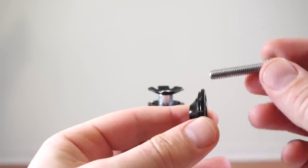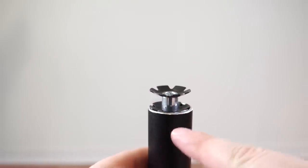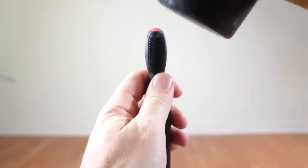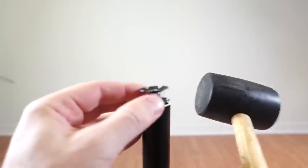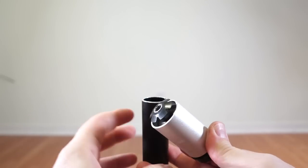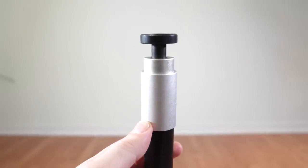At the top of this steerer assembly you have the preload bolt that goes into the top cap, and this has to be screwed into something — that something is the star nut, which has to be pushed inside the steerer tube. Installing the star nut can be done on the cheap with just a small screwdriver: slide it in from the top, get a mallet, and start whacking it down 10 to 15 millimeters. However, I'd highly recommend getting the star nut tool, which costs about 10 bucks — it pushes it in exactly centered, not crooked.